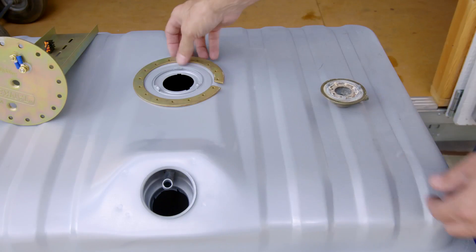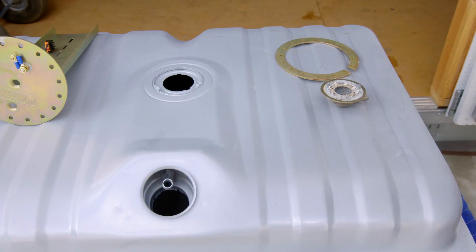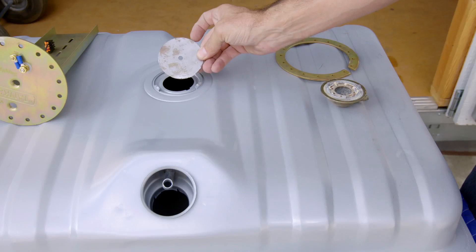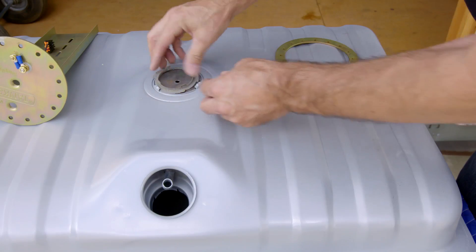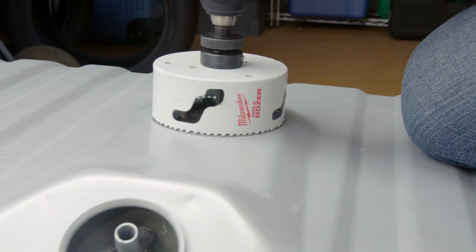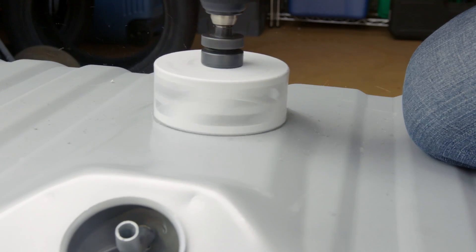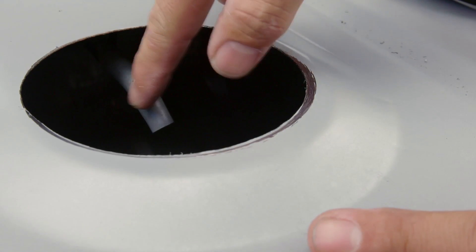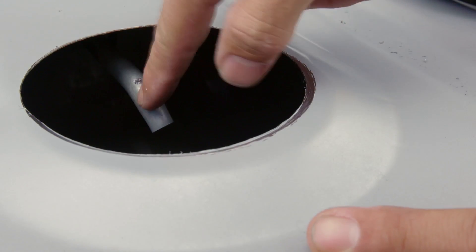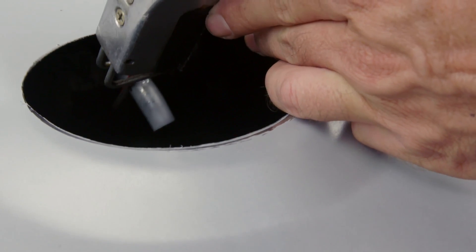The trick is to figure out a way to drill a four-inch hole to insert that thing. My idea is to just take a three-inch hole saw, cut a little sacrificial piece to mount in there in place of our old vent, capture that, and then get our four-inch hole saw — and that will drill us a perfect four-inch hole around this little vent opening here. Since this tank has this vent tube that used to go up for a vented gas cap, I'm going to lose that as well. All I have to do is just clearance this and take the edge off to be able to fit this thing in here.